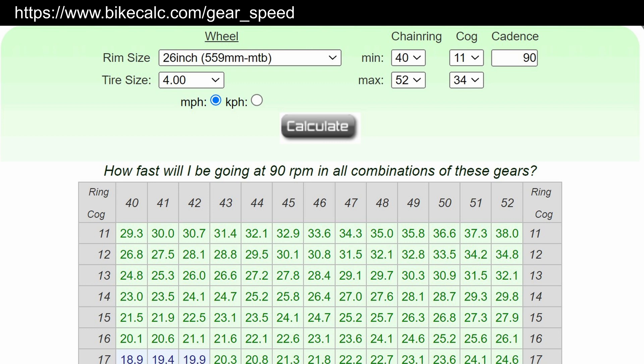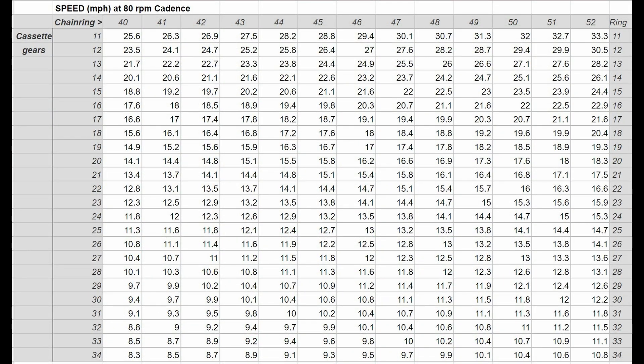To find your cadence, you can check the speed on your current bike, if you have one, and using the calculator, enter the correct wheel, rim, and tire size and gears, and adjust the cadence to find your speed. There are also Bluetooth RPM and speed sensors that will attach to your bike and can be read from your phone. I hope this helps you to better navigate the growing number of interesting e-bikes and to choose one that meets your needs.